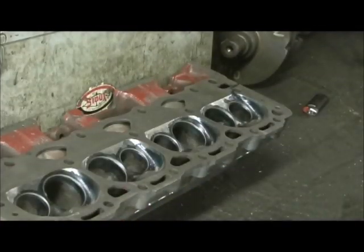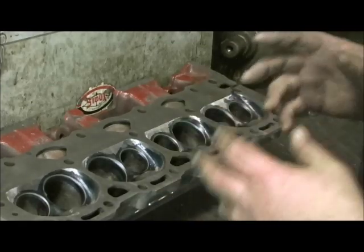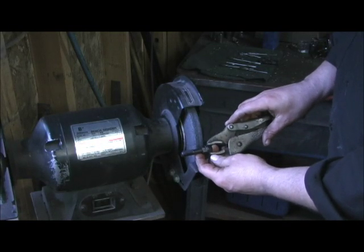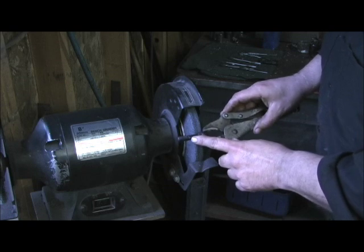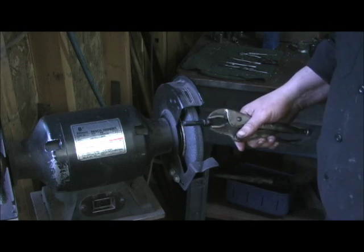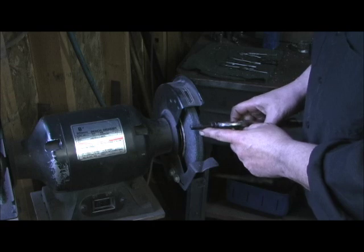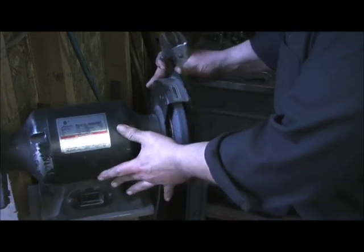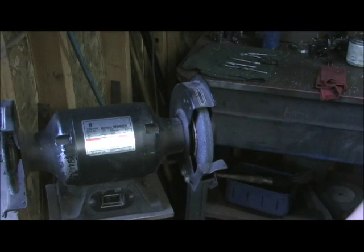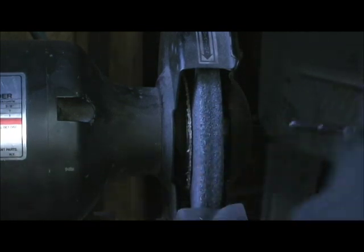I'll note when I get back from washing and cleaning, there are some areas I want you to see in the prep work. Now, this is a rocker stud — notice it doesn't have a wrench head. This is an old trick for doing an economical set of screw-in studs. It helps people who can't afford the $140–$150 for a real set. Right now I'm trimming the stud because it's about a hundred thousandths too long.